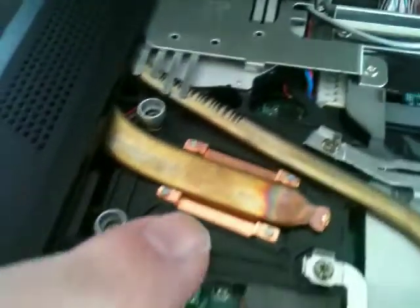Look inside the Lenovo ThinkPad R61. This is the inside. I'm changing the processor for a Core 2 Duo. There's a CPU there, I think, under this black part here. Well, there's the heatpipe assembly and the heatsink. Just got to get the bezel off.